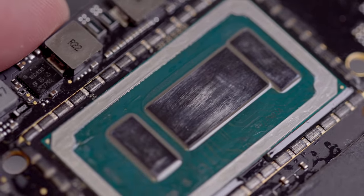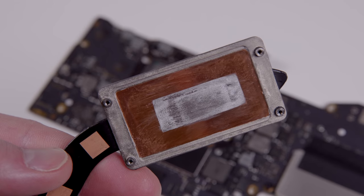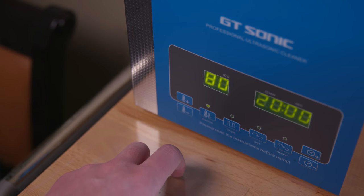Do you have any thoughts? Because I honestly am a little bit perplexed. Regardless, after a rubbing-alcohol-infused cleanup, there is visible alloying on top of the CPU die — see how it isn't really shiny anymore? And the CPU cooler, well, it still looks super silver; it doesn't even look like I did anything, even after a ton of alcohol rag treatment. Now, this doesn't affect performance in any way, but I still wanted to see if I could remove it, especially because Apple might give me trouble if I ever need to get my keyboard repaired under their new extended replacement program. Thank you for finally admitting fault for crappy design, Apple. So I used an ultrasonic cleaner to penetrate the tiny pores of the copper metal.